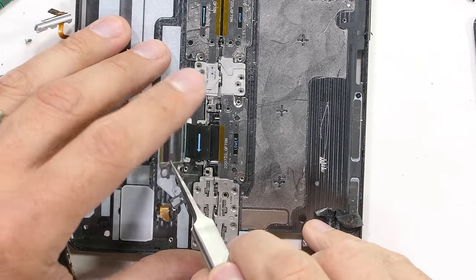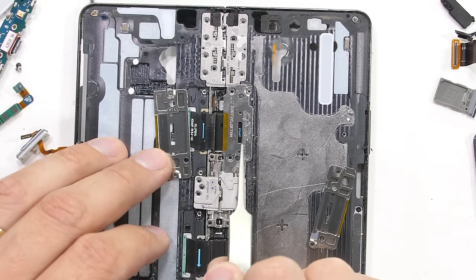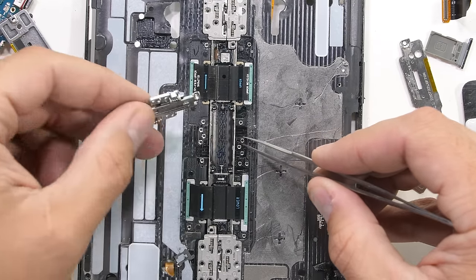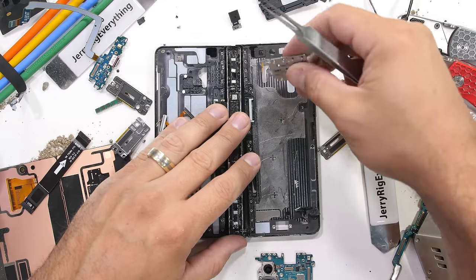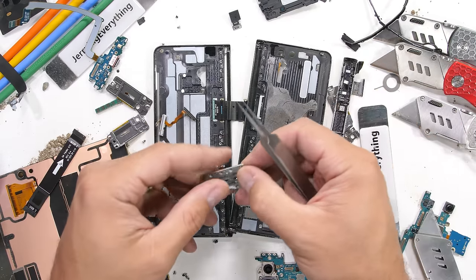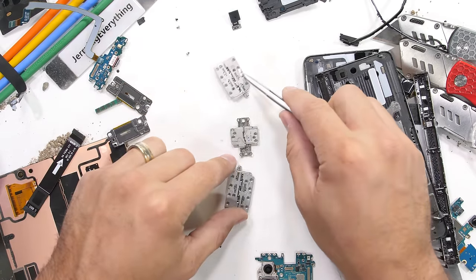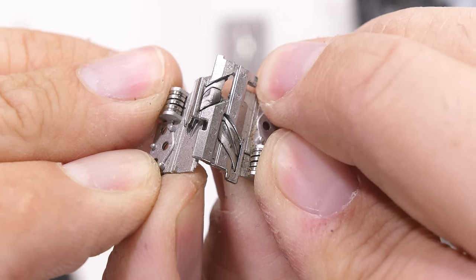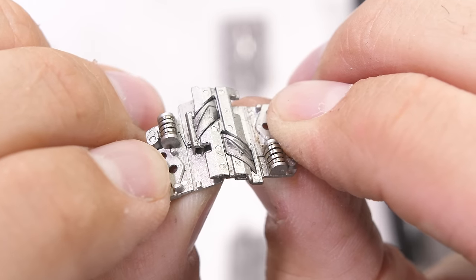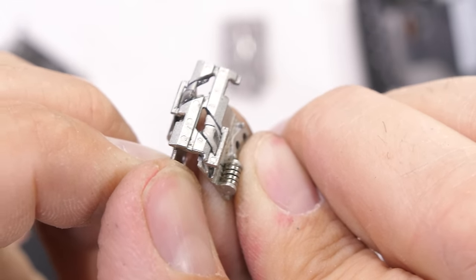With all those screws gone, we can see that the new hinge is sectionalized, with metal plates connecting 3 separate hinge components. Last year and each year before that, Samsung gave us a complex construction of minuscule little spur gears that help guide open and close the fold uniformly. This time around, the metal halves are guided through little channels, using grooves and joints instead of gears. The center hinge constrains and locks the motion of the two halves as it rotates into itself.